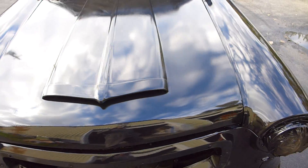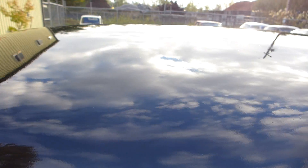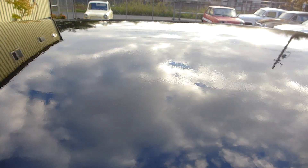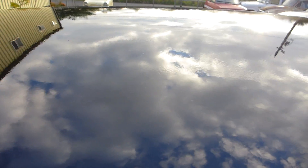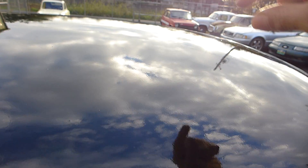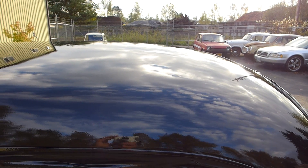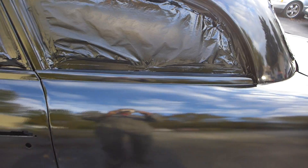The whole car got a couple of really good coats. There were some rust pits on the roof that I had a devil of a time trying to get rid of. I think I finally got them — I just kept hosing it on there until they filled in. They were right across here, one set there and one set there, and even though I blocked it a bunch of times with some high build I just couldn't get rid of them. So it's looking pretty good.